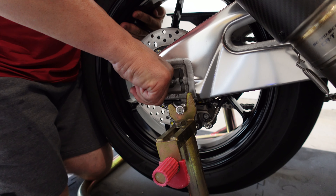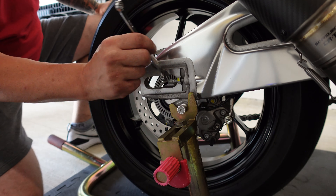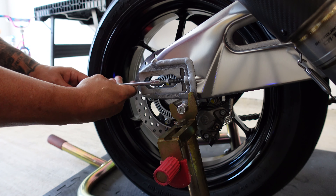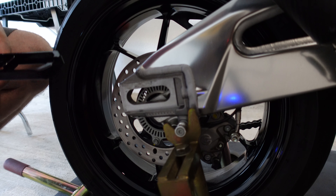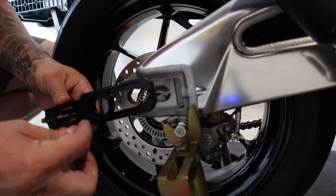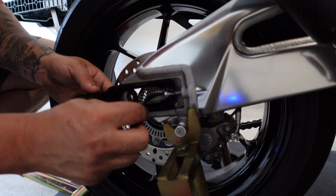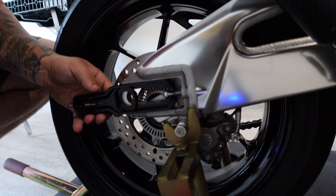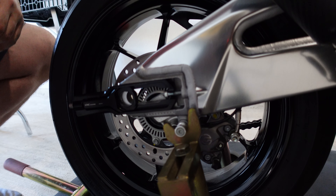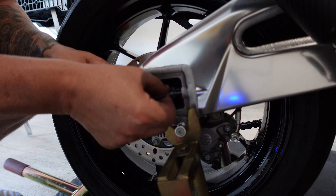You should be able to just lift up on the tire. After fiddling with this for a bit, here's what you do: take the adjuster and run it all the way back so that when you go to put it in, you can still get your allen wrench in on it. I can't use my socket anymore because it's too long, but I can still use an allen wrench. Let me take this out and put some Loctite on it first.